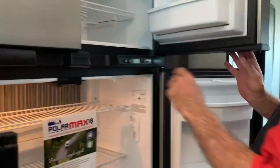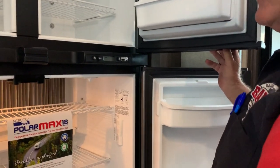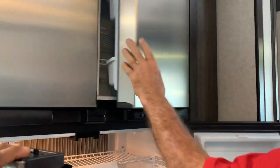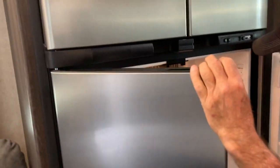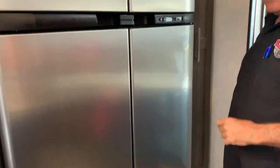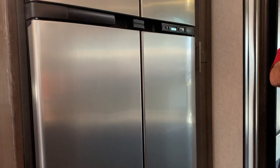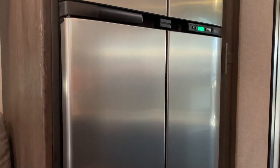This is going to be controlled from here — how cold that is could freeze your food. You won't lose any food. Now you should turn it off like that. It doesn't take long to turn that back on if it's cooled down — it's not like gas and liquid fridges that take 24 hours. You can turn that back on and give it 30 minutes and it's going to be getting cold.